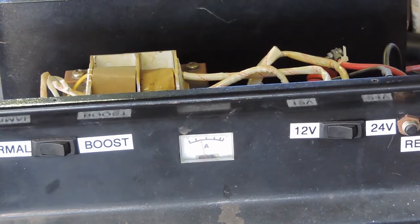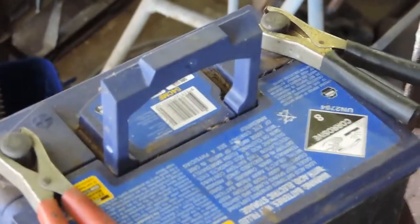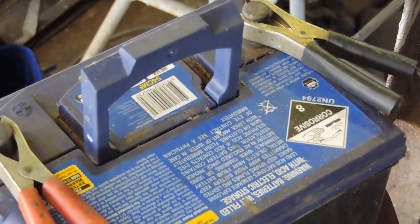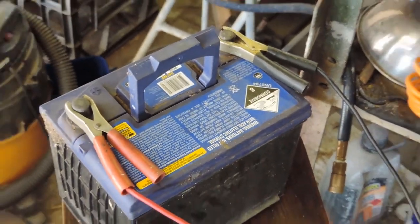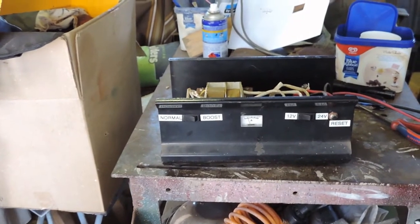What I like about this — I've got a modern day electronic charger that does all wonderful things, but if that battery is dead flat, the new charger won't even look at it, just ignores it, acts as if it's not there at all. One thing good with these old chargers — which is just a transformer, a bridge rectifier, and a couple of switches — there's no voltage sensing or anything like that, just a straight up transformer. It doesn't care about the battery; if the battery is dead flat, it will just continue to try and pump in as much power as it can. Which is good, because at times I've needed to just do that.